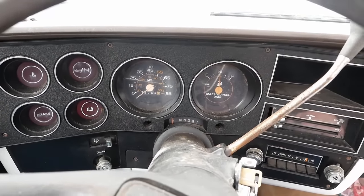On a hot start, let's say the engine's cooled off slightly, but not 100%, the bimetallic spring in here is still gonna be opened up somewhat because it gets heat from the whole engine, not just from the heating element here. So that's kind of important. That's why they don't just use a timer. They have to use the bimetallic spring. So you let the engine sit long enough, it cools off, you tap the throttle, and you're back to where you started. There's the clock spring. Let's go to the bench and I'll show you the problem.